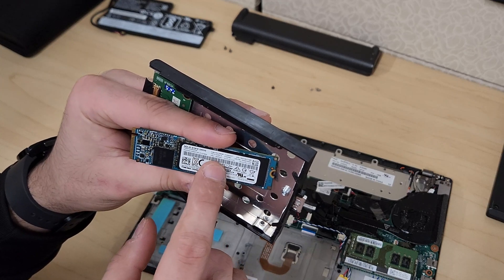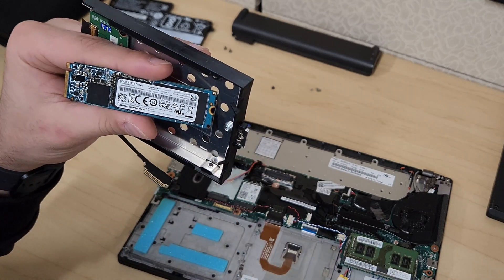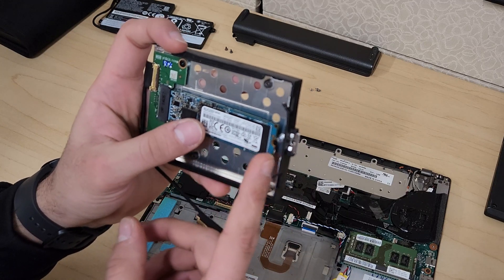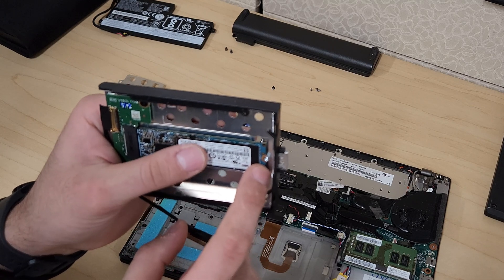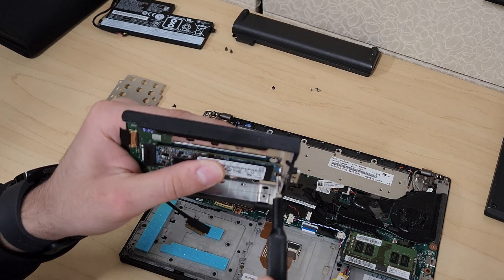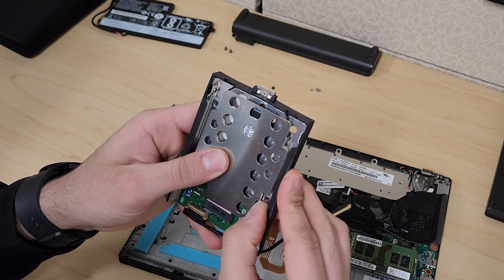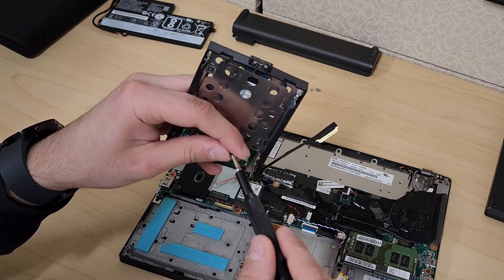If you look here you can tell where the lower barrier is — that's why it has the notch. For example, if you try to put it in the wrong way it won't go in. This M.2 specifically is 256GB — of course you can buy an upgrade to 500GB or one terabyte. To put the M.2 back, push it in all the way, drop it down, and you'll see it's perfectly aligned with the screw hole. Take your screw, put that back on, then take the cover, align it with the screw holes, and put those screws back on.